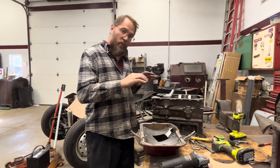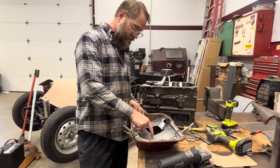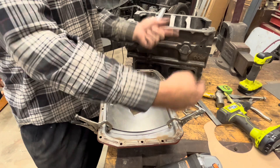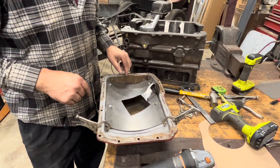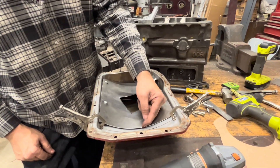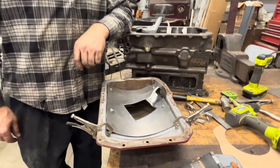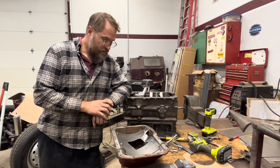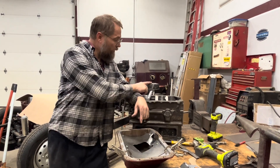So that's the basic windage tray done, except I've got to put some slots in it for windage — because as it whips the oil around, you want a couple of slots in there for it to drain back in. I may take a little bit more off the front here so I get a good drain back through here. That's pretty much it for this for now until I get the rest of the oil pan built. Next time we'll get into the actual baffling around the oil pump pickup screen.